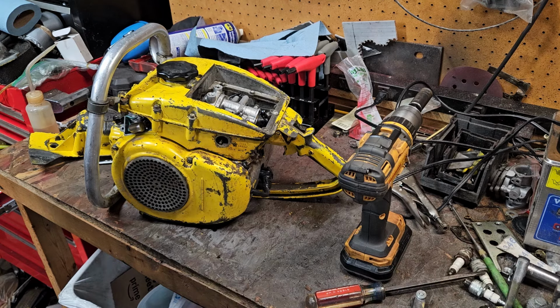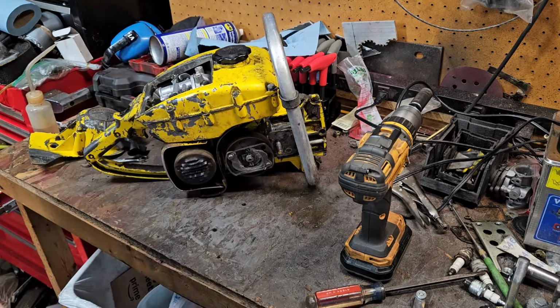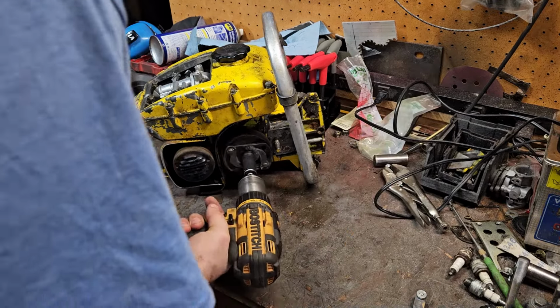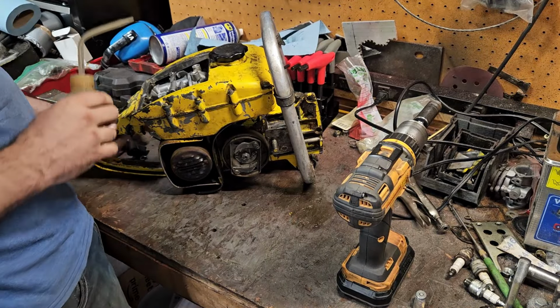So somewhere, there's something not correct with the saw, like from the factory, unless it's the coil or something. But it is a hot blue spark, and where it's supposed to be, it's not fired. But we'll give it a try here. But something is not happy somewhere. I need to see if I can find a Nova chip. Rob it off of something and see if that's going to do the trick for us, because that's not correct. Because even then I get spark outside, but under compression it's not.